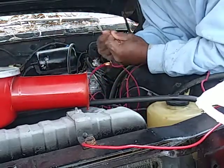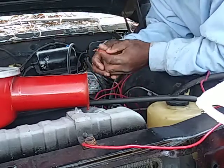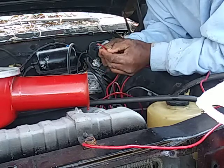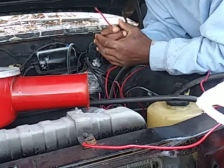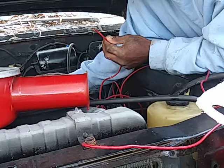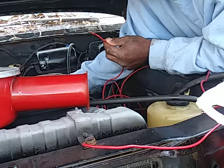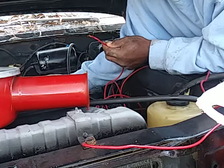So it goes in there to the inside of the car, hooks to the pink wire. We're gonna have like 2 wires to the pink wire: the one coming off the starter, the one coming off the electric fuel pump. And I'm gonna run a toggle switch so I don't have to run into the pink wire. Yeah, we're gonna have to have both of them running. So we're gonna have 3 wires running into the pink wire, which is the starter wire.